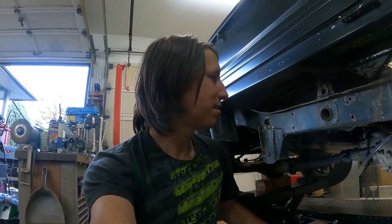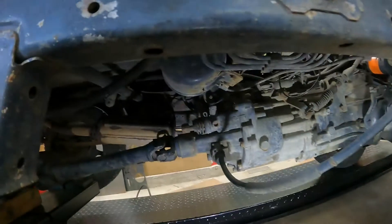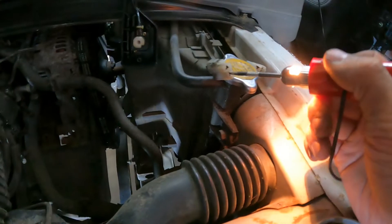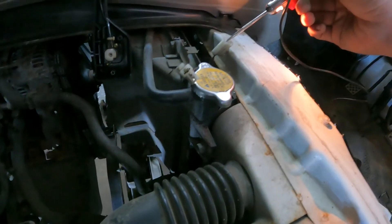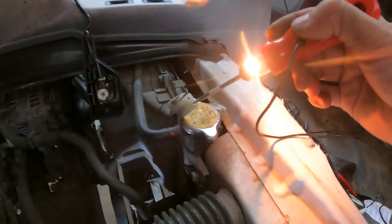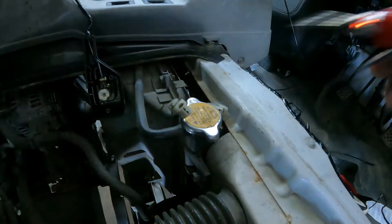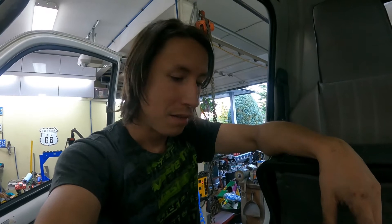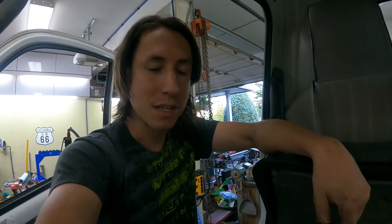Assuming this wiring works the way I think it does, when I push this forward the test lamp should illuminate — and it does. Looks like success, so we should now have power to the front differential lock. Interestingly, you have power on both plugs when four-wheel drive is engaged, which is the same thing happening in the back. I'm going to do some quick tests on the front solenoids to see if one is normally open and the other normally closed, because if that's the case it might indicate we have the wrong solenoid in the back.